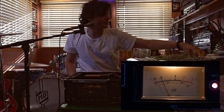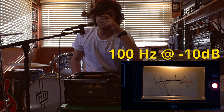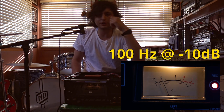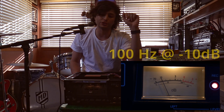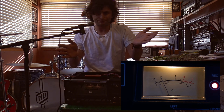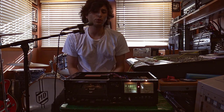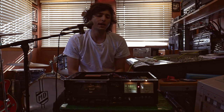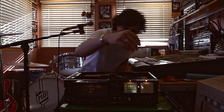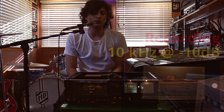My control desk is sending a 100 Hz signal to the left channel of my cassette deck at negative 10 dB. When doing cassettes, you always want to do this adjustment at negative 10 dB as opposed to zero on the VU meters, as you would normally do on a tape machine. Let's record about 10 seconds of signal onto the tape. Once about 10 seconds is recorded, we're going to feed the 10kHz signal at the same level, then do a playback of both signals. All right, so now let's do the 10kHz — we are now recording the 10kHz, and the tape counter is working, so that's good.